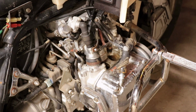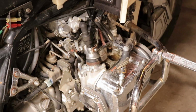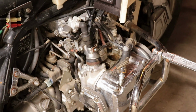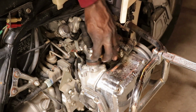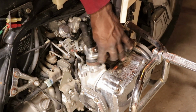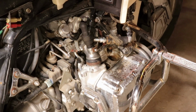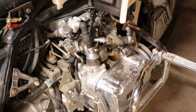When I do that, the fuel system light comes on. Oh, wait a minute, maybe that's it. No fire. Look at this, it's a baby spark. I don't know if you can even see it in the camera. Maybe I'm not getting a good... It's a baby spark, though. Yeah, it's firing. It's a weak fire, but it is firing.